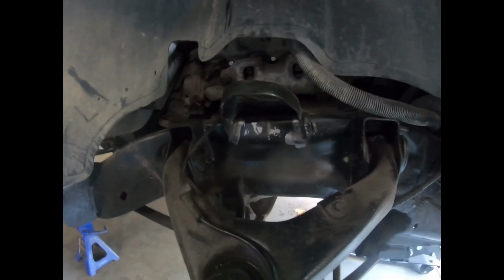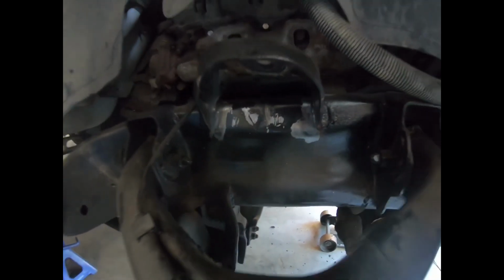So guys, right in here is where I'm gonna throw a bead of weld on this shock tower. It's because it's a shock tower and not actually meant for a coilover to support it. There's lots of guys that do it. There's also my buddy Derek, who has some. He hit a really big bump and one of these kind of ripped off the frame because the welds are very mediocre because it's only a shock mount. So I'm gonna throw some new welds in there and clean it up, and then paint it one more time because I already cleaned this up a long time ago. And then once it's done, then I can show you guys what it looks like with the coilovers in there.